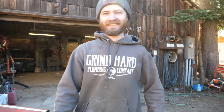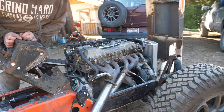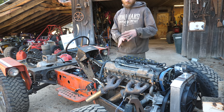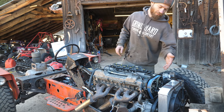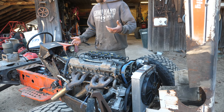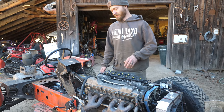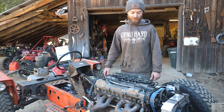There's a regular idle once it warms up and idles down to 950 RPM — there it is. A little bit of oil burning off the exhaust, the usual things. There's still a ton of tuning to be done, and obviously eventually we'll have to get it on a dyno and properly tuned. A lot of the maps we messed up because Casey was changing fuel maps trying to get it to run before we figured out the cam sensor bolt problem. Casey got it just barely back to idling and revving a little bit. We can't drive it right now anyway because there's no clutch and no brakes.